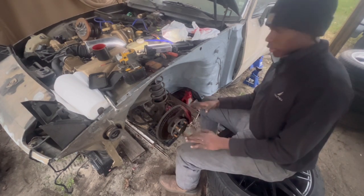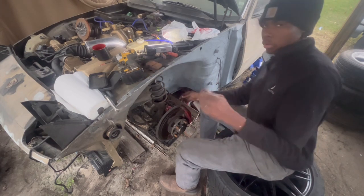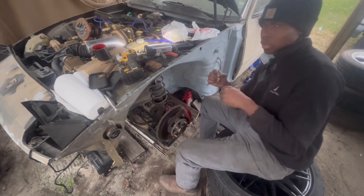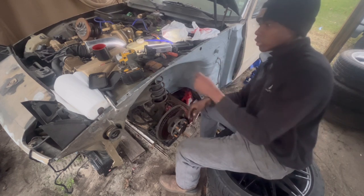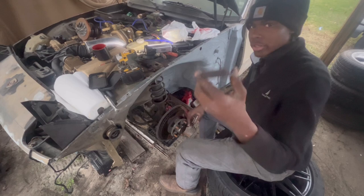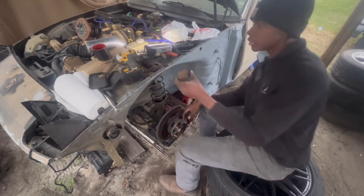The first thing I want to do is remove this caliper. On the back side you have these C-clips — it's really one safety clip for both, but apparently I had two clips on each one. Remove the clip out, knock this bad boy out this way. Then we got these brake pads. I might reuse these — there's plenty of meat on here, so I might reuse these.